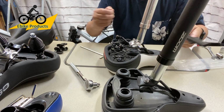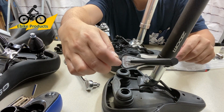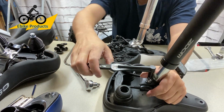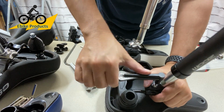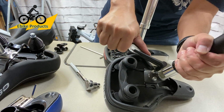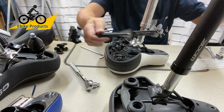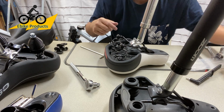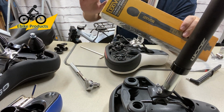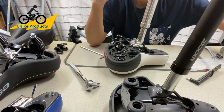Okay, so I have my cheaper one here, and as you can see, it has its reading here. When I try to tighten this, it'll go up to the 10, and that's when I know where to stop. Okay, so that's 10 there. Of course, it's an adequate one if you don't have one, because these things are quite expensive. I'll have the link below so you can take a look at it. But this is one that I'll be using on all the parts on the bike, especially in the handlebar section. You want to have a good torque wrench so that you don't strip something.